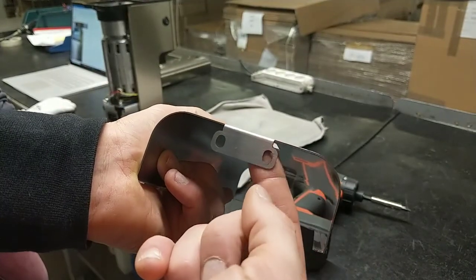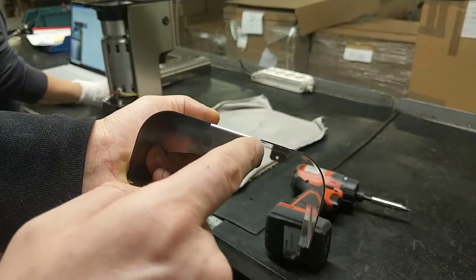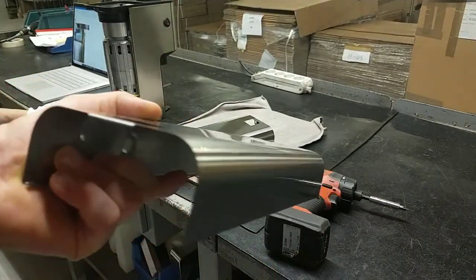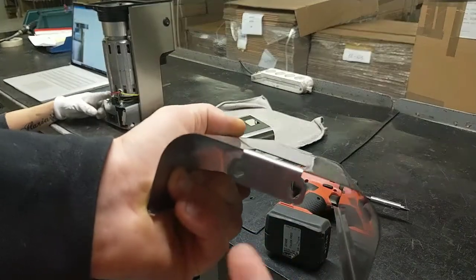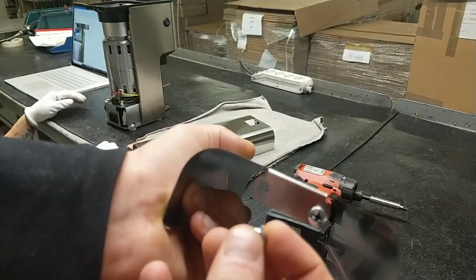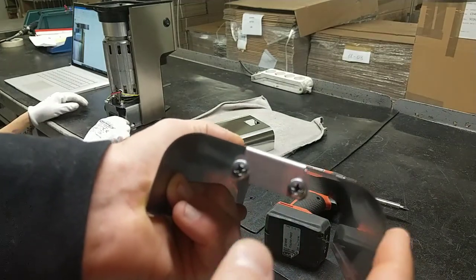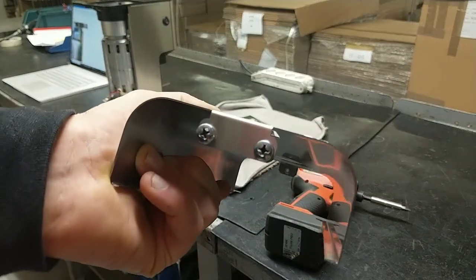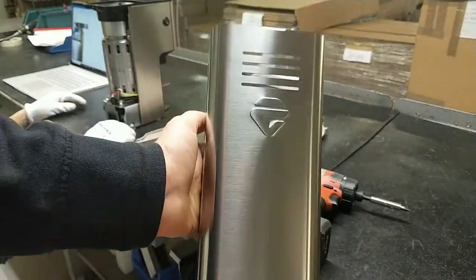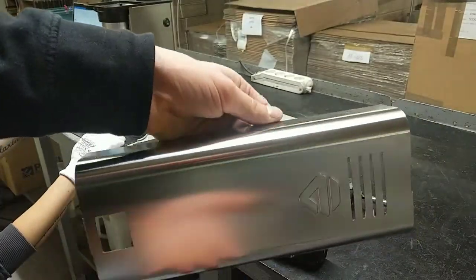You can see here — it's not open — but with a screwdriver you can move the plate that you can find in the old version, and you can open here. When you open this, you can screw the two screws, code MC268, and you can fix these two screws. With two screws you have less vibration and the coffee grinder works better.